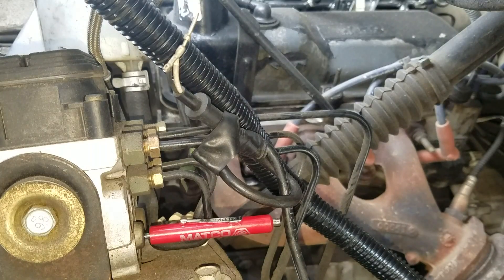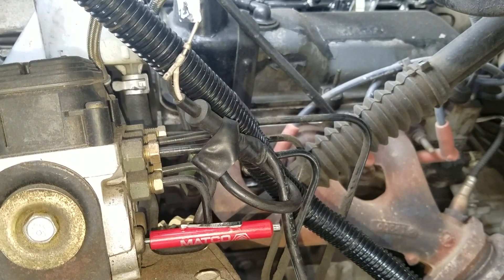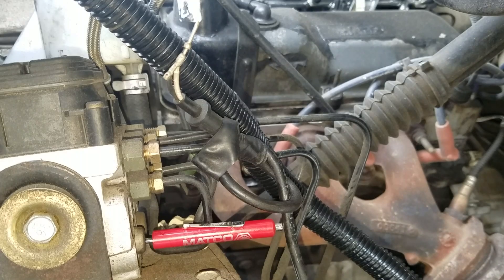At this point my next test will be going to the hydraulic unit because I'm thinking that one will be bypassing. The instructions are to press and insert a paper clip or screwdriver inside those two little holes on the hydraulic ABS control unit, then go and press on the brake pedal. Normally if this unit is good, that screwdriver shouldn't move more than a quarter inch, equal to 7mm.